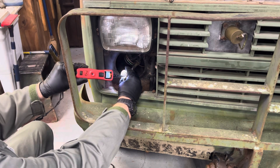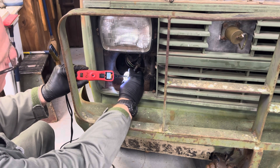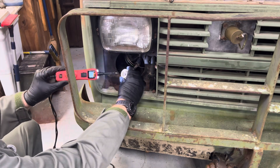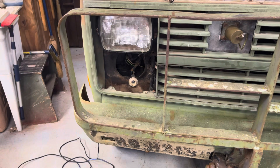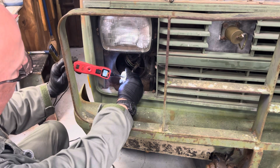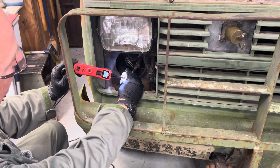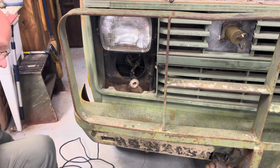Neither one is working for that. Oh — there's 10.6 volts, so brown is the running light. But as we found out on the new piece, that's going to be yellow. Let me turn the blinker on. Now the blue one should be flashing — 10.6, nothing, 10.6, nothing. So blue is the blinker and brown is the running light.